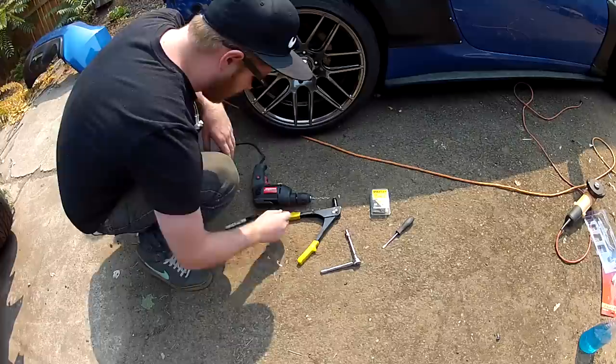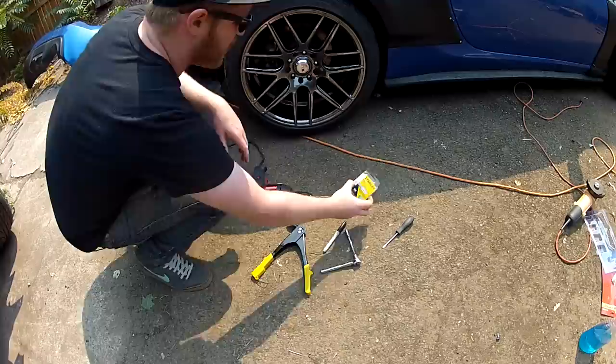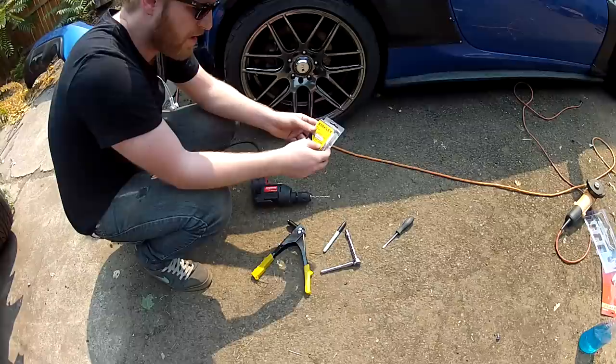To test fit your wide body kit you're going to need a couple tools: a 10 millimeter socket, flathead screwdriver, a Sharpie, a power drill, and most importantly a rivet gun and the right rivets. You need a rivet gun that fits your rivets — the ones I'm using have a quarter inch or six millimeter grip range, which is really important to get through the body kit and into the metal of the car. I'm using aluminum ones with a diameter of 3/16ths or five millimeters, so you'll also need a 3/16ths drill bit.